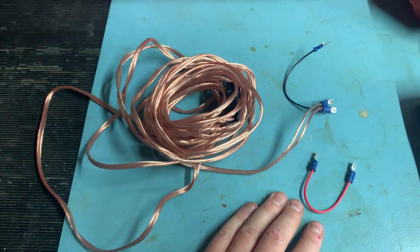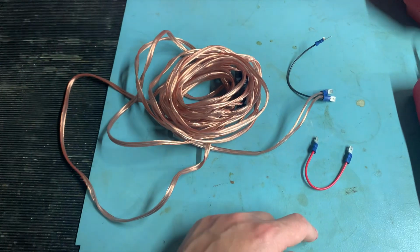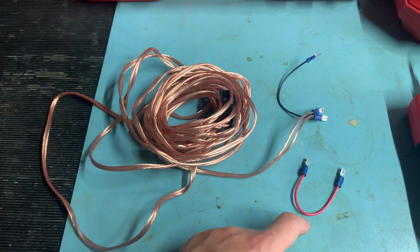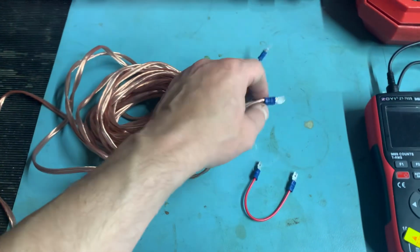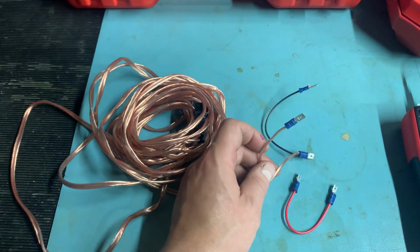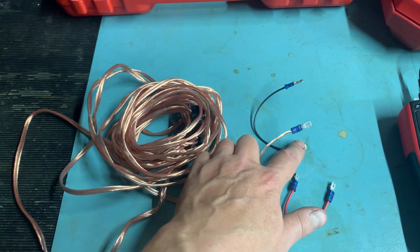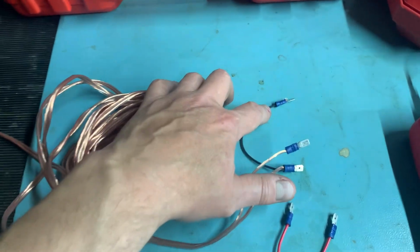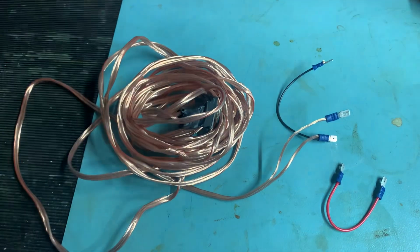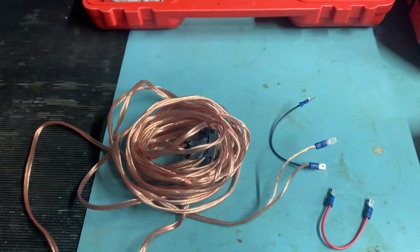The RPM relay also controls the lambda relay. So there's 2 outputs. There's a live in, and then there's a live out to the fuel pump, and then there's a live out that goes to the lambda relay to make the lambda or the frequency valve operate. So this slightly better version is the same one. I can't remember the colors now, but you basically put that into live, and you put one into the fuel pump output, and the other one into the lambda relay output, and then I've just got a simple toggle switch on the end of it, and the toggle switch just lets me sit in the engine bay and then switch it on from the engine bay.